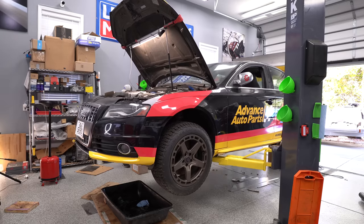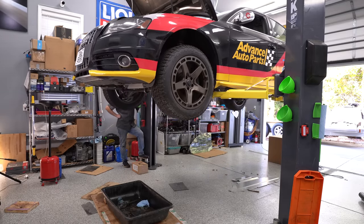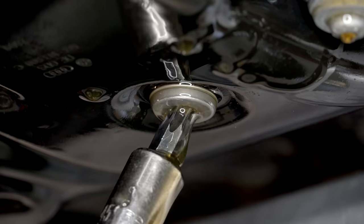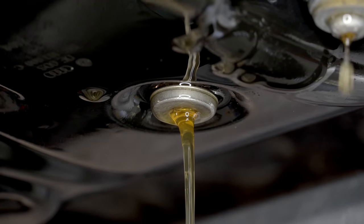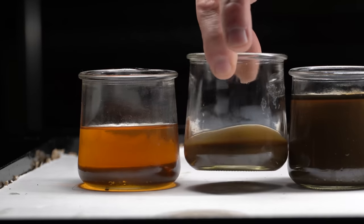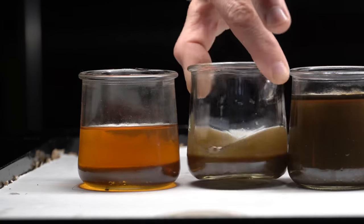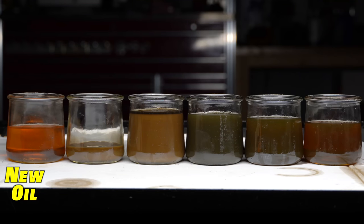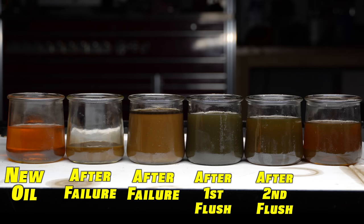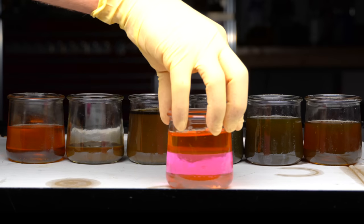Let us crack the drain plug just like we did for the other ones. Let's go ahead and get our sample. Oh, look at how clean that is. While that drains, let's look at our progression of oil samples. This one is what I first pulled out of the engine and never let it separate — this was actually what I was going to send off to Blackstone. Starting on the left is a sample of clean engine oil. The next two are the ones I initially pulled out of the engine. You can see on this one where the dirty oil has risen to the top and the rest is the oil and coolant mixed together. Then we have after our first flush, after our second flush, and then after our final flush where we ran the actual engine flush solution. And just for fun, this is what it looks like when you just pour engine oil and engine coolant together.